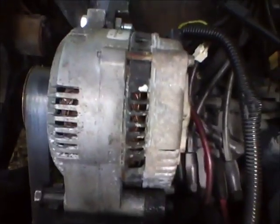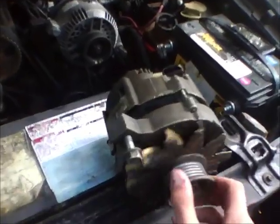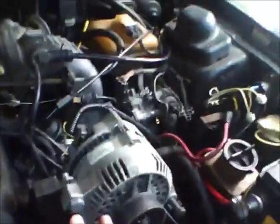I'm not actually going to take out this alternator because it's already in there and I don't have my tools, but I'll walk you through the process. Basically, the 65 or 75 amp second gen alternator and most of these third gen alternators will fit in and out of each other — the casings are about the same size.